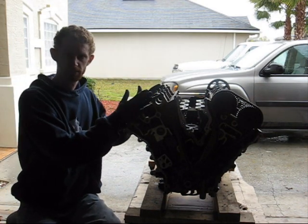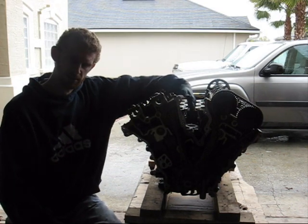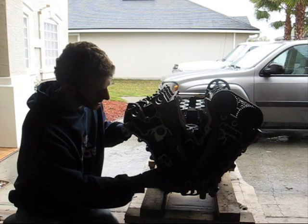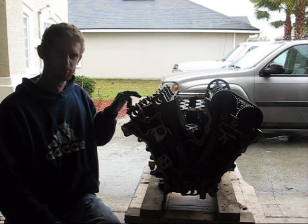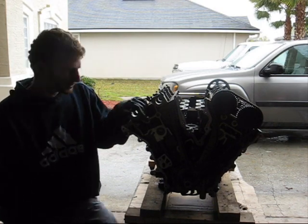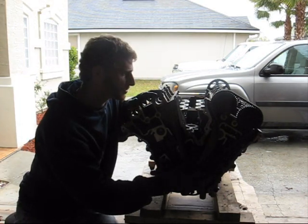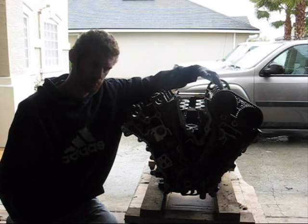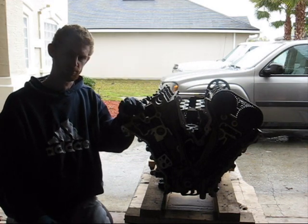This head has already been unbolted — I had to crack it loose in order to get the engine mount out of the valley. I've already removed the camshafts and all the timing components from the front. I have not, however, taken this head off, so I don't know what it looks like underneath. The first thing we'll do is remove all the timing components from the front and remove the camshafts. That'll allow us to get to the head bolts. We'll take the head bolts out and pull both heads to see how the combustion chambers look.